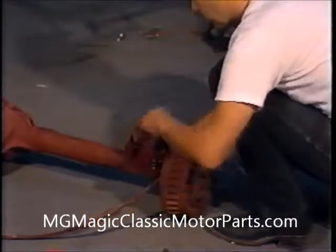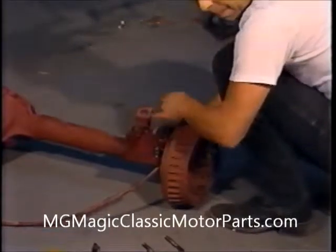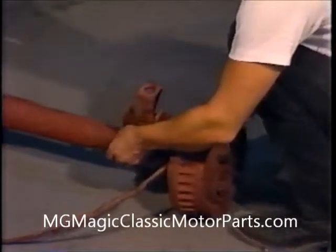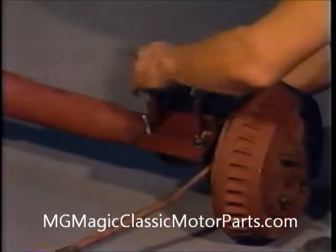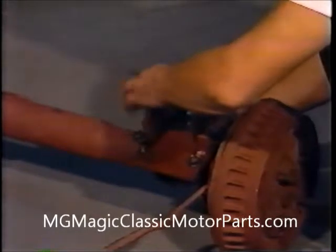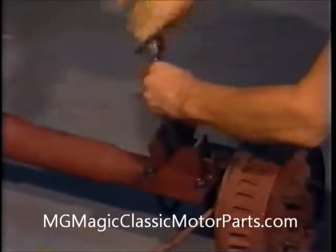The entire rear axle assembly along with the brakes were cleaned and inspected earlier. Any worn or deteriorating parts were replaced. We used a quality primer to paint the unit. Later, we will paint everything with a high-quality black enamel paint. For visibility during filming, the primer will be left on. The appropriate socket extension and ratchet are used to tighten the nuts on each side.